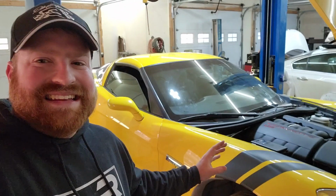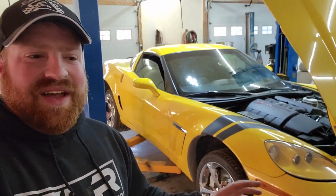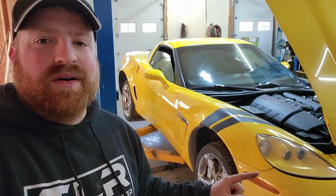Today, we got the Corvette in the garage. Now, we inherited this from my dad, and obviously pretty sentimental, but one of the things it needed from the get-go was the harmonic balancer. Today, we're gonna tackle that. It did need a few things. We did brakes and a couple other things, just normal maintenance stuff, but the typical harmonic balancer issues that the LS motors have, this one has. It wobbles real good, popped off the AC belt on its own. And so we got to fix that. So we got some goodies here to pop on it, and we're just gonna get into it.